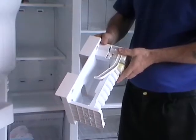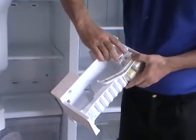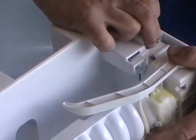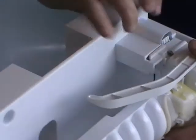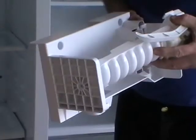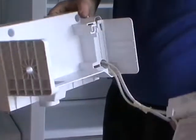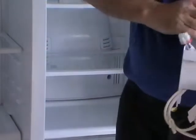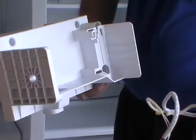To remove the ice maker from the housing, there's a tiny little sprung-loaded clip — clip it and the ice maker will slide upwards and away. Then it's just a question of wiggling the ice tray out, and the electrical lead comes out through that hole. To refit it all would just be a reversal of that, which we'll do now.